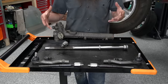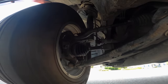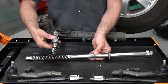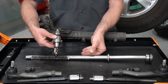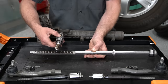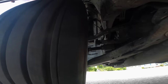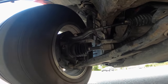Our power steering system turns a circular motion — rotating the wheel back and forth — to a linear motion of the wheels turning left or right. I've taken apart this power steering body to show you what it looks like inside. This piece right here is what attaches to the steering column, and the steering wheel attaches to that. This piece drives this shaft right here. So as I turn the steering wheel one way, it turns the wheels — this would be left. If I rotate the steering wheel the other way, it rotates right.